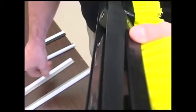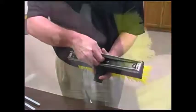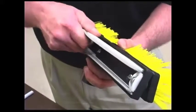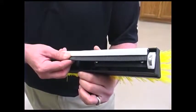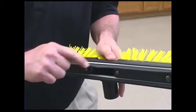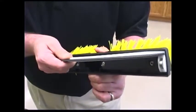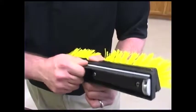Replacing squeegee blades is a very simple process. With the squeegee head removed from the vacuum wand, pull up firmly on the center of the worn squeegee blade until the front edges are freed from the wheel housings and pop the blade out of the squeegee head. To insert the new replacement blade, slide one edge into the slot and under the wheel housing with the ribbed edge of the new squeegee blade facing out. Next, bend the squeegee blade so the back edge can be placed underneath the opposite wheel housing and seat the new squeegee blade in the slot.